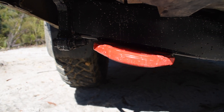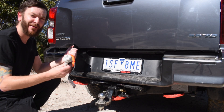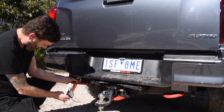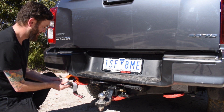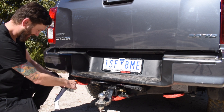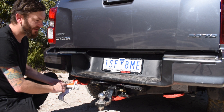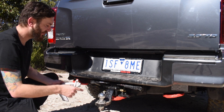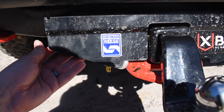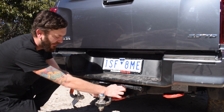What's great about these recovery points is they're actually chamfered — they've got a rolled edge — meaning they are soft shackle compatible. We've got a brand new MaxTracks soft shackle here, simply pop it through. Really tight being brand new — but look at that, super handy. You can link both side points together with a bridle strap, or you can use this centre point here, which as you can see behind this cover has a pin and a nut, so you do actually need some tools to remove it — not a big deal.